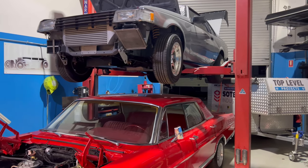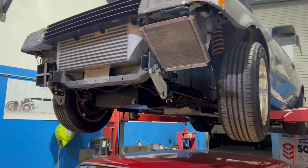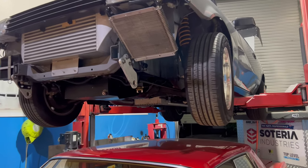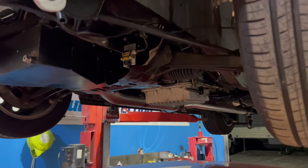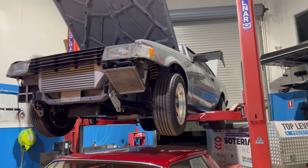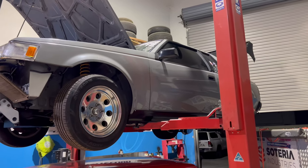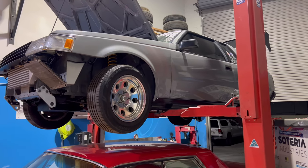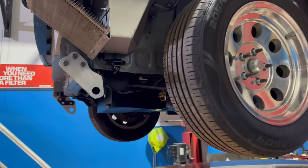Welcome back — it's 5 o'clock the next morning. I started up the engine yesterday and the engine sounds pretty happy, so I'm stoked about that. Unfortunately there's quite a bad leak out of the front of the transmission pump. So that gearbox has been away and had a new seal put in — maybe something's happened there. We'll get the box out this morning. Old Bags is coming down to give me a hand, and Dan's coming down later to get this radiator shroud on.